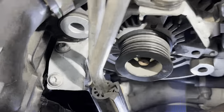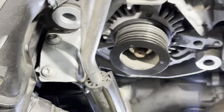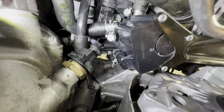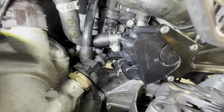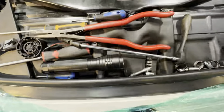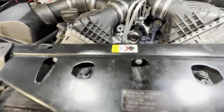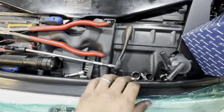These two bolts are in. I'm doing a second bleed procedure — usually you want to do two or three bleed cycles before starting the engine. Those three bolts are in, connector is in, both hoses are in, still not leaking — that's a good sign. Use a little swivel like this for the top bolt, and then we're going to put that bolt back for the charge air cooler intercoolers. Some of the tools you'll need: a little T10, quarter inch, a T30 on a swivel, a pick for that connector, and needle nose pliers to get the hoses on.